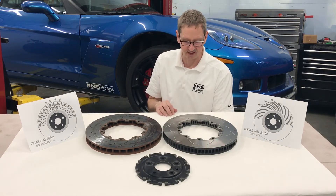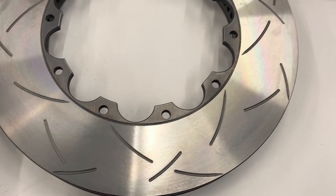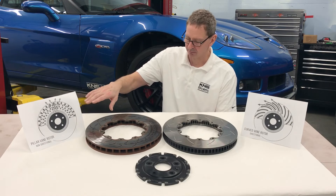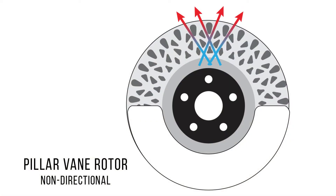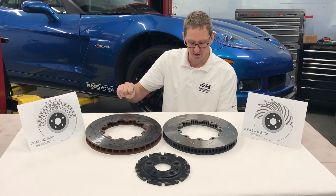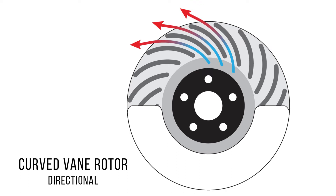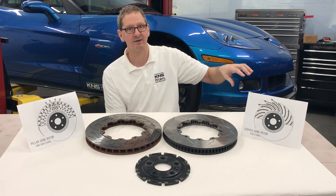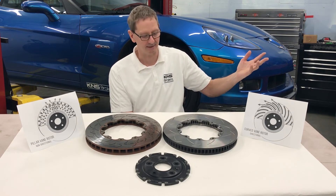The differences, as you can see, are quite a bit. This rotor has a slightly different slotting design, but the primary differences are in the vane design and the materials. The GM rotor in this case, made for the Brembo setup, is a pillar vane rotor — non-directional, weighing in at about 20 pounds. The replacement rotors made by DVA are a curved vane design, so we have left and right rotors. This allows more air through the rotor and adds a longer vane to increase mass, all benefiting heat absorption and heat rejection, which is of course the rotor's main task.